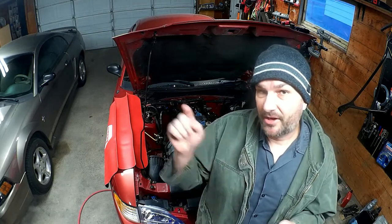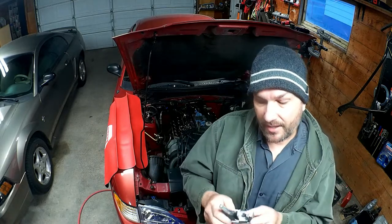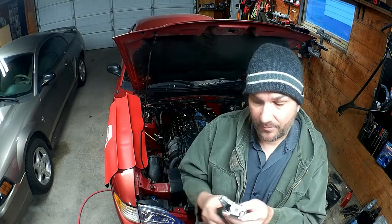And these springs don't have a lot of coils. They're not a foot long. They're little short guys, so they only have a couple of coils. You can really only grab one or two coils up from the bottom where it actually spreads out, because the first coil and a half is already stacked. So you only get to grab the first half of it, and then you have to compress all the way down with the first half. That doesn't leave a lot of room to get the keepers.